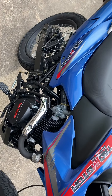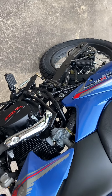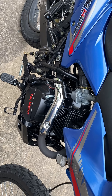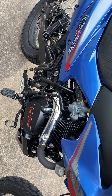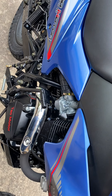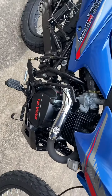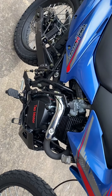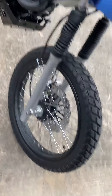So, carburetor. With this carb, I never actually used the factory carb — the factory carb is somewhere in this garage. I went straight with the Mikuni carburetor and I had trouble with it at first. For some reason it was sticking. It was running basically wide open and this pipe glowed red, it got so hot. Luckily it wasn't anything crazy that damaged anything — it was just that it was being held wide open the whole time.